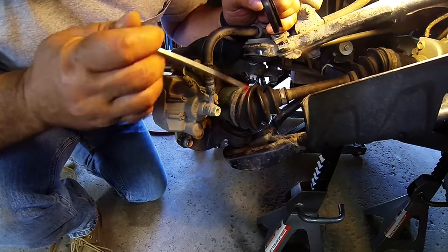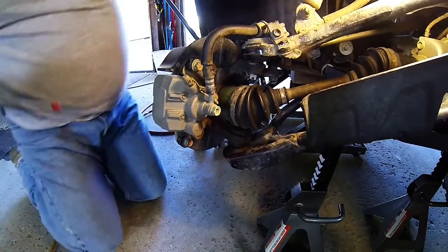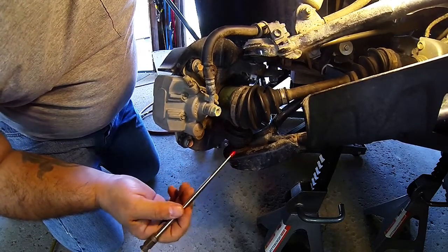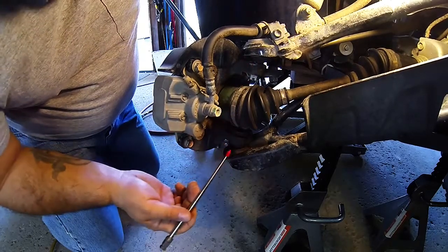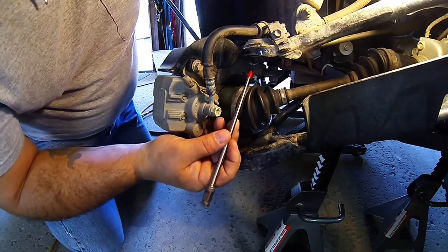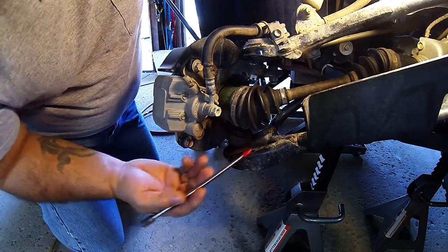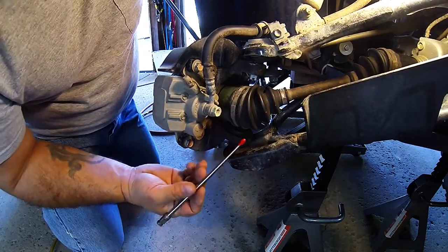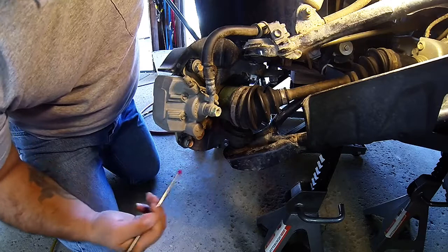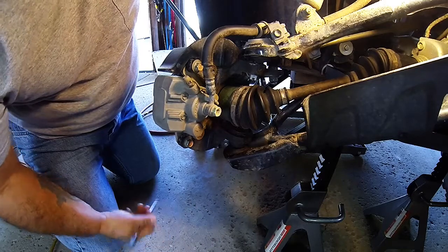So then I reassembled everything, but I didn't have the torque values. And torque values are pretty important on a machine. Number one, the assembly process. You don't want to be cracking pieces, like your knuckle, because you've tightened them too much, or you draw them in too much and you'll never separate them. I don't even know if that's a root cause or whatever, but I put it back together, and what I thought was the value is what I did it to.